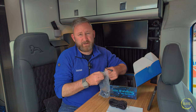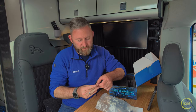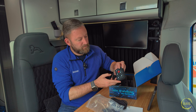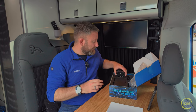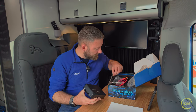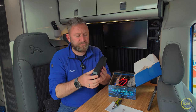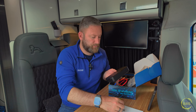When I looked at this I thought it's quite quirky, and it's a similar size to the other switching panel I've used - the buttons feel quite good. This is a six-gang IP68 rated waterproof panel - you can even have these outside on a boat if you wanted to. You get the switching panel, wiring looms and stuff. What I thought was quite good is you get a bag of buttons - courtesy lights, loads of different icons. You push them into a rubber bit and then you've got your button in it. You also get a 60-amp breaker with it, loads of wiring, terminal wires, fuses, and a piggyback fuse for the ignition.